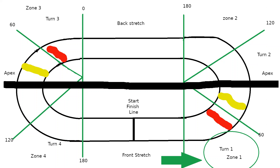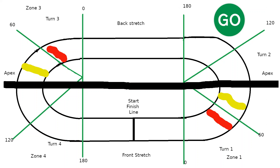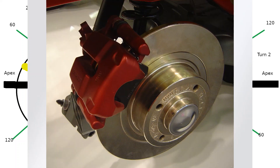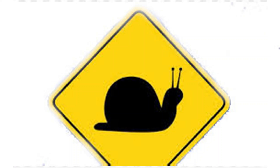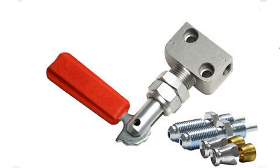You want to go through those turns as fast and as smooth as humanly possible. Then it's up to when the driver gets back onto the gas at the apex — how fast can the engine get up to RPM? Because once that suspension unloads and the driver hits the gas, you want it to instantly respond and rocket off of those turns. If you're applying too much brake going in too hot, or the brakes are set up way too hard, it slows the revolutions down so much that you're losing time — losing tenths of a second. Braking can be controlled through other classes through different boxes and designs, but with a stock class it's very difficult because you're limited to what the factory produced.